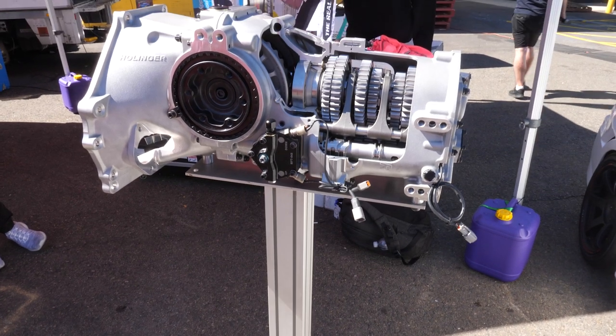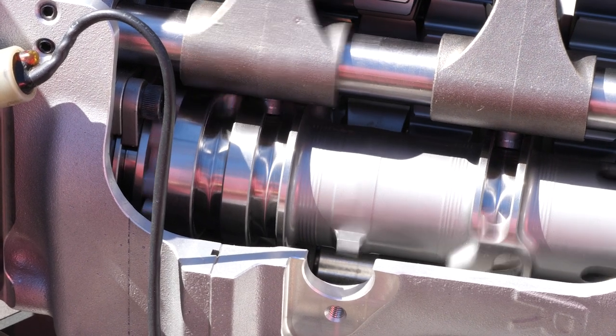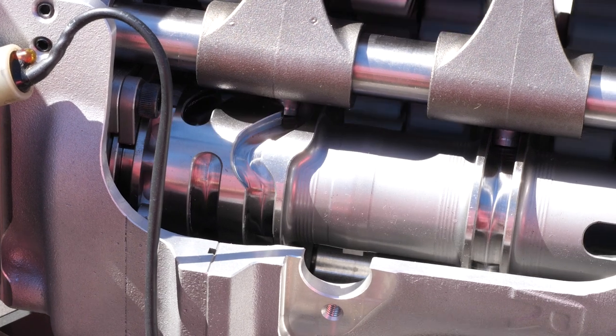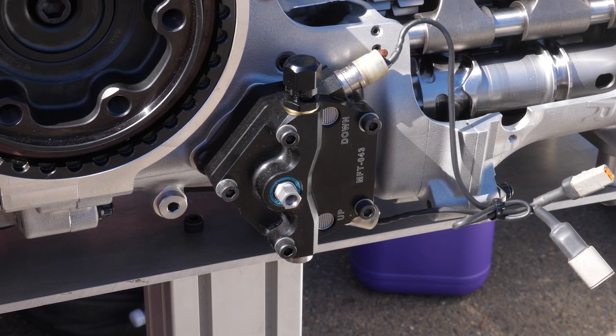This dog engagement technology can be applied to a conventional H-pattern gearbox, or alternatively can also be used with a sequential gearbox. The sequential gearbox, as its name implies, means we are simply pulling a gear lever forwards or backwards in order to select a higher or lower gear. This starts with a shift barrel with machined paths for each of the selectors to move on, which must be precision machined to ensure the different selectors won't simultaneously engage two gears. Once you've got that drive barrel installed, it's not a big stretch to add pneumatic actuation — which is how we have paddle-shifted gearboxes.